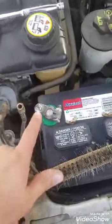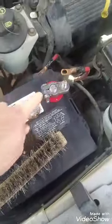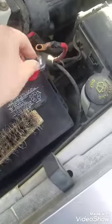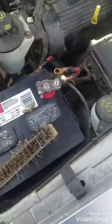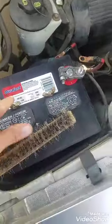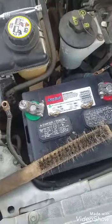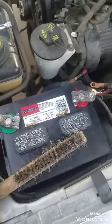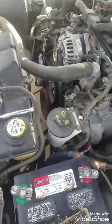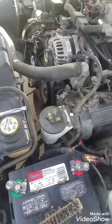So the battery cables are off. I'm going to clean up these terminals and the ends of the cables on both positive and negative side, and then put it all back together. Maybe add a washer to both of these to give it a little bit more of a grab, and make sure that these wing nuts tighten up. If they don't tighten up like I want them to, then I'll change them out for some hex head nuts. Then we'll turn the car back on and make sure that it's charging. If it's not charging, then we'll move on to bench testing the alternator — even though that thing looks brand new.